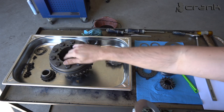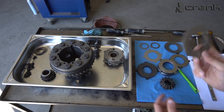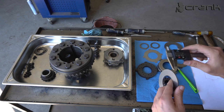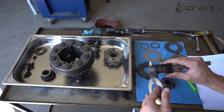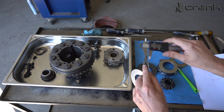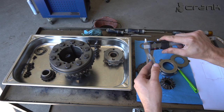As we saw previously, I needed one more millimeter in the casing, so I decided, rather than removing 1 millimeter from the cup, to remove 1 millimeter from the shim, which was originally installed from BMW on the bottom of everything. But because I was lucky enough to find a workshop with a lathe, which doesn't know how to work with it, they made it 2.8 actually, but after that I made it 2.5, because Racing Diffs have sent me this 0.5 millimeter washer, let's say, and together both of them are making exactly 3 millimeters, like that.